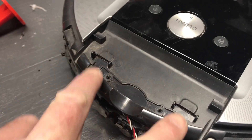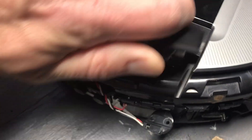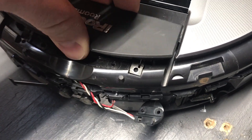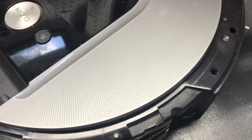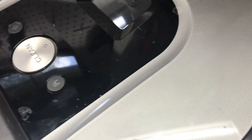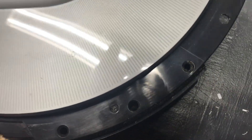I've got the handle off. To remove it, you take out the two accessible screws and then there are little clips that slide in and latch — you get the screws out, twist it until the clips come free, and slide it right out. I've also got some of the back bezel off; that just pops off — it snaps on the front and snaps down with no screws.